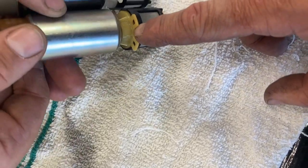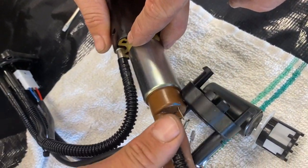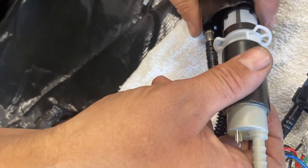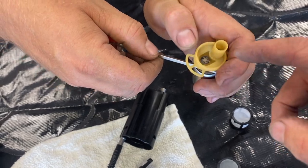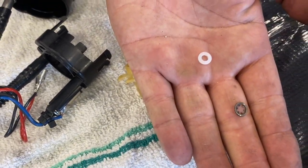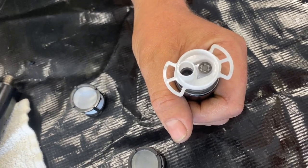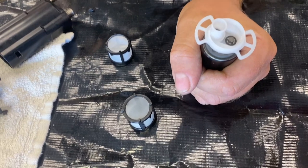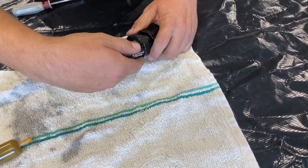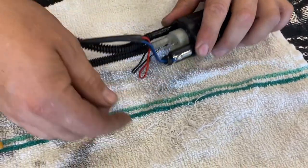On this one, you can see this one has a little V cut right here; the new one doesn't. This V is clearing right here and it clears nicely on this one — we're going to have to cut this one away in this area. As you pry up on this old outer filter, you can get these two little clips off. There's one clip and the other one's like a little washer spacer — we'll need those for our new one. We've got our clip on here; we're just going to push it on with a 6mm nut driver — it just presses on, it's a press fit. We're dropping our pump altogether back in and the clips just clip right in place.